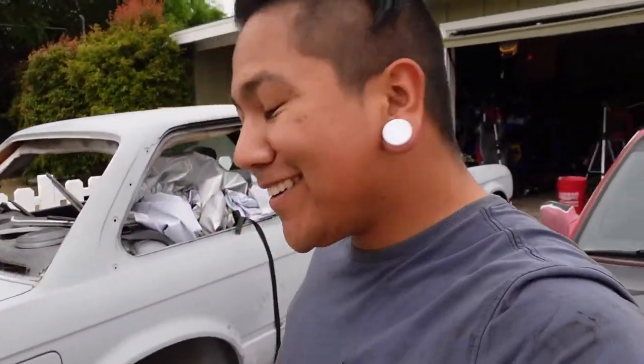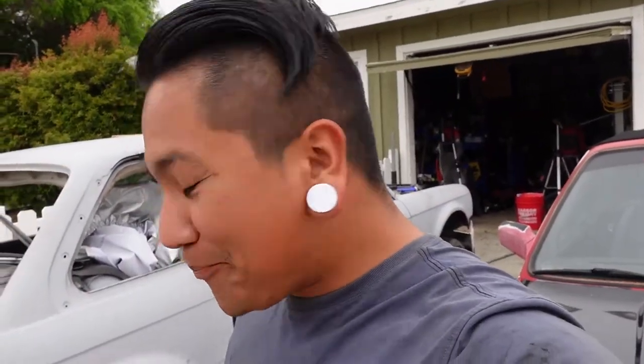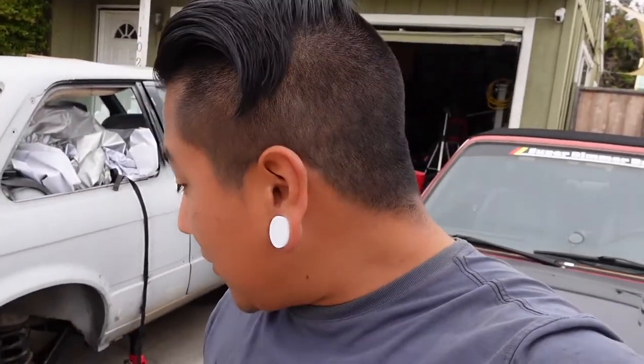All right, with the snap ring out, now I can actually start pulling the bearing out of the hub housing. I'm not sure what it's called, but you pull the bearing out of the arm, the trailing arm. To do that, my preferred method throughout the years of doing these is using a slide hammer and the correct size cup, I guess you can call it. I've tried multiple different ways, and for this application, because it's a brand new bearing and I know that there's no corrosion on it, it's gonna be pretty easy to pull out this way. So let me show you what I got.